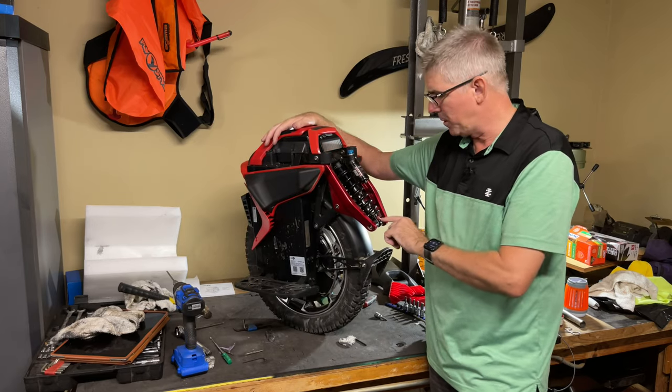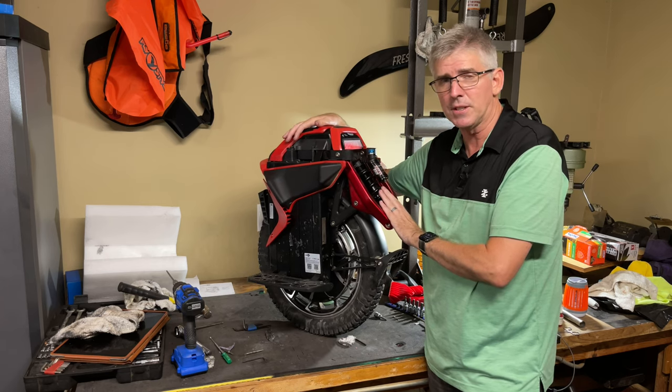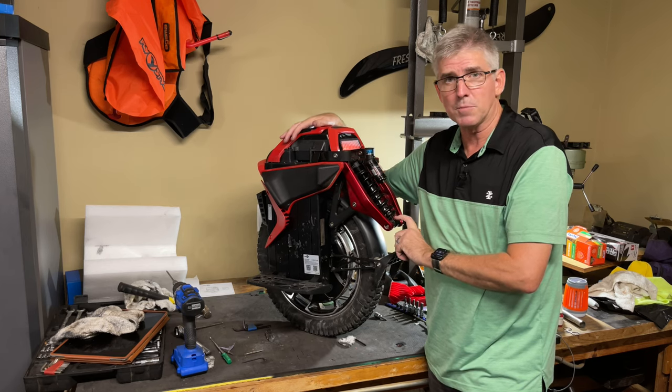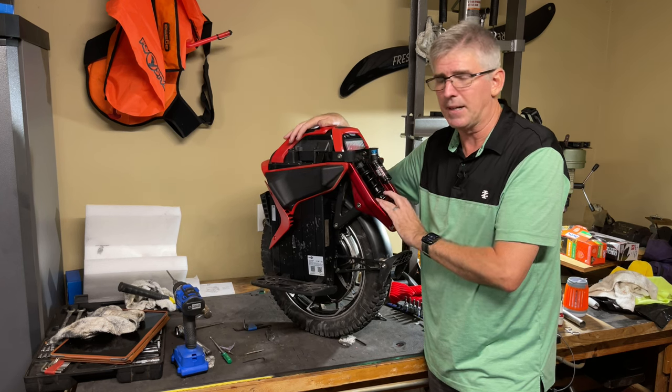So one thing that I wanted to mention as well is now the rebound is much faster. I had everything turned all the way down because there's less friction in the suspension system now. I think I'm going to have to actually adjust my rebound dampening because the system is now working, I think, as it was intended to do. So I'm super happy about this project.